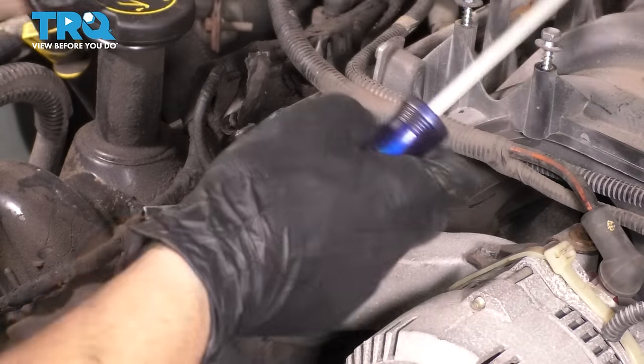And while we're here, let's plug in the throttle body, or the throttle position sensor, that is. Over here, just like that. On these studs here, I had these ground connectors, which plug into this harness over here. Plug that in, secure it, finish bolting up that nut. So I'm gonna just make sure this is all clean, put it on, and tighten up this nut. And of course, we'll do the same to the other side.